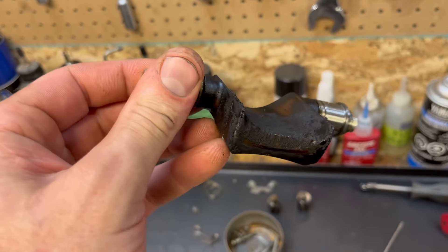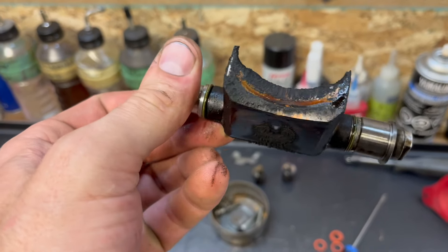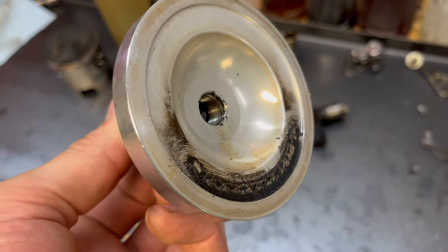Power valve is all apart, and I would say that this is on the nastier side of the spectrum — that is more buildup than I expect when I open up a TPI. I've run exclusively Motorex, the proper oil, and I did that deliberately from start to the first hundred hours, and now I'm switching over to the Blood two-stroke oil. So if you follow me for the next hundred hours of bike use, I'll have another report for you because I'll run exclusively Blood for the next hundred hours. That being said, oil ratio and the type of oil is not the only thing that's going to affect this buildup — it could have to do with the way that I've jetted the bike or set up the mapping, it could have to do with heat range of the plug, or the way that I ride. That buildup also makes me wonder if it's related to the type of oil that I'm running.